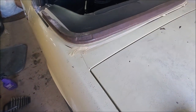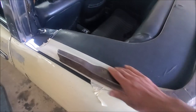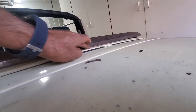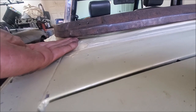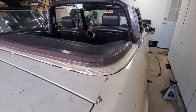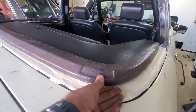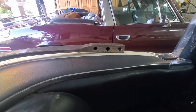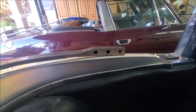This is the rail that was having problems. I masked it up and as I showed you, it's supposed to have a curve at the back but it sits flat. I can put my hand in there — probably about half an inch, or about 10mm — and I've got the same gap on this side here, about 10mm. Chris Spain mentioned you can put pressure on it to fix that. Those are the three holes that give you adjustment back and forward — maybe a quarter inch either way.